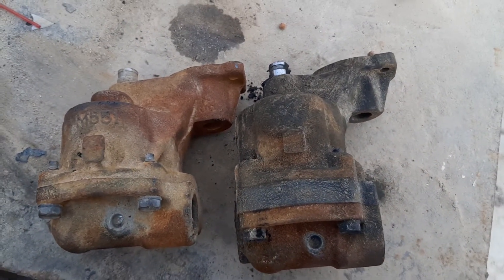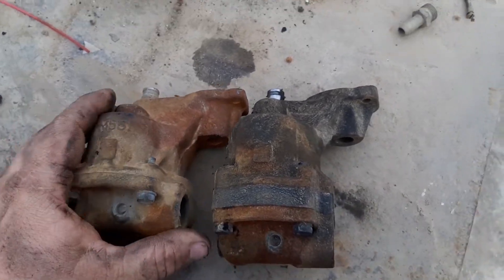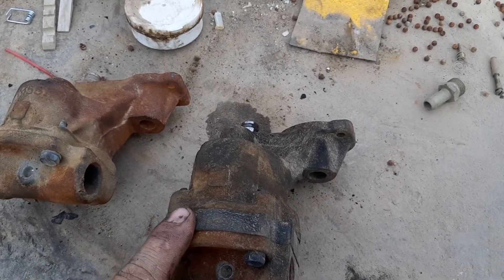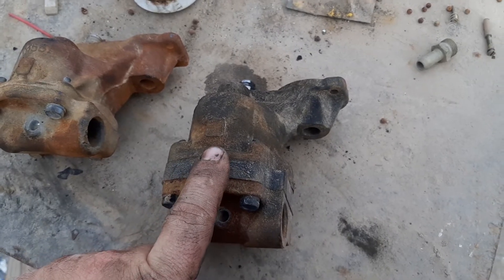So it's going to add that much more volume. The reason why the late model pumps are bigger is because of the oil squirters in the blocks. The blocks that have oil squirters in them spray oil at the bottom of the pistons to keep the pistons cool.